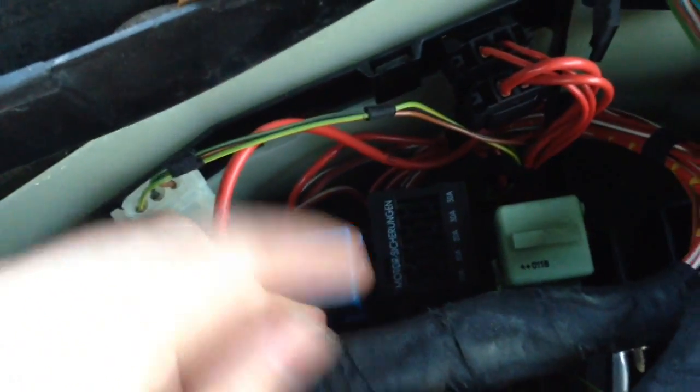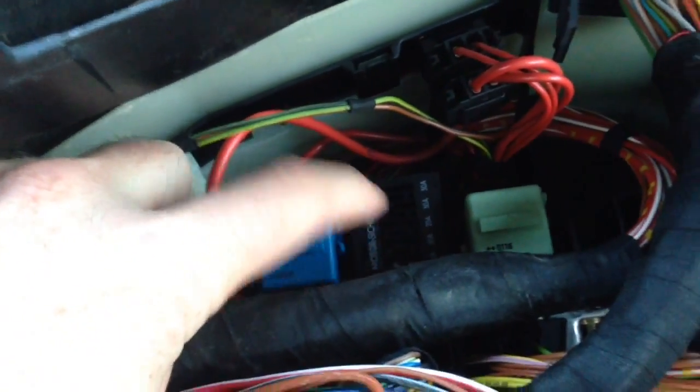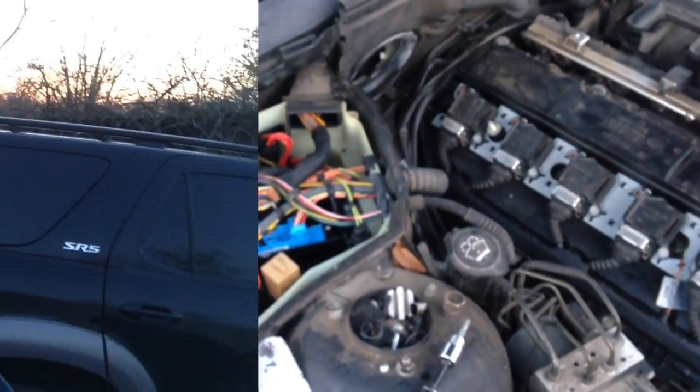So I went and popped the box off up here, and back down here there is a little fuse box that holds 5 fuses. One of those fuses was blown. I had to replace that, and the car started right up. And also the seat, the steering wheel, everything started working. I doubt that had anything to do with the fuse that was blown. I think that's solely for the starter. Also, or the ignition, I'm sorry.